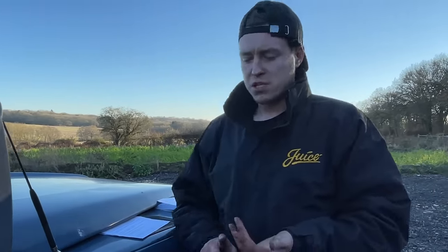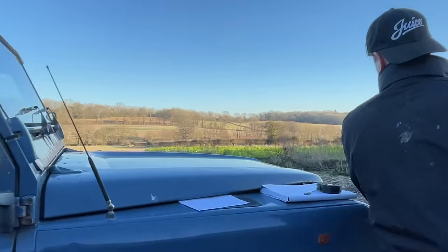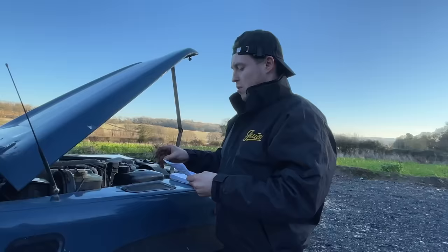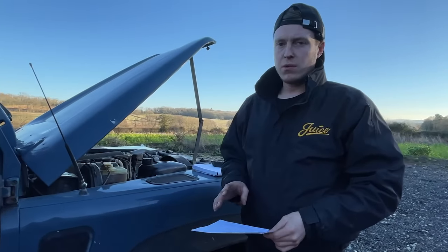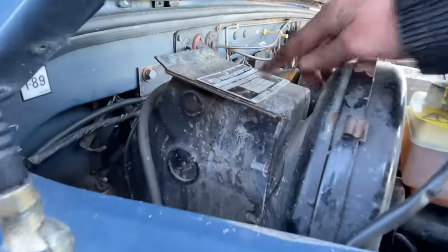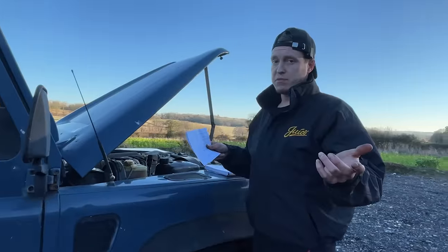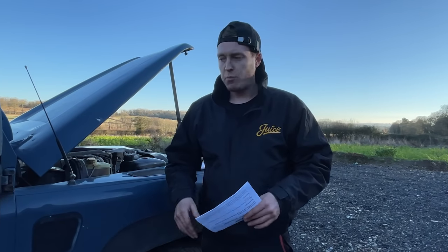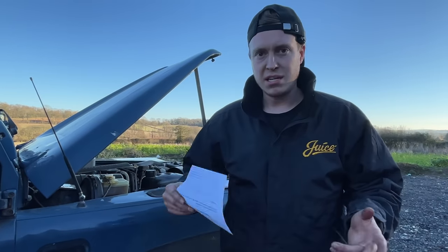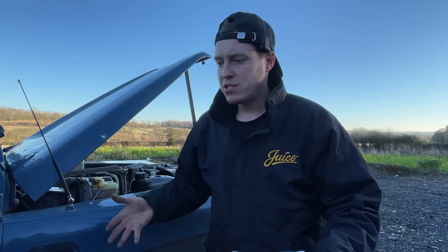Once you're happy with the car, ask the owner for the service history - if any at all provided - all the paperwork, the books, the manuals, and make sure the numbers match. Once under the bonnet, check the VIN tag - this is the vehicle identification plate, and make sure the number matches the number in the windscreen and marries up to any paperwork provided. There's also a free government tool where you type in the number plate for an MOT history check - it'll bring up the whole vehicle's MOT history, any previous fails, and you can see any mileage discrepancies. If the vehicle suddenly failed and then passed in a day without anything being done, that's always a big red flag.